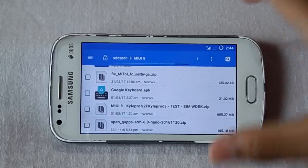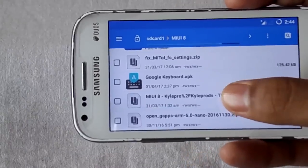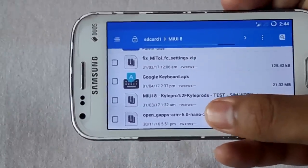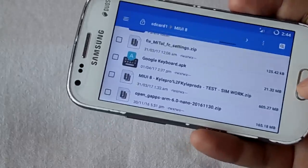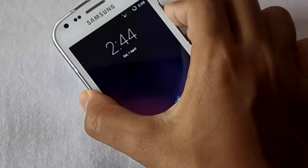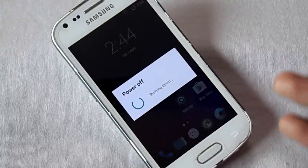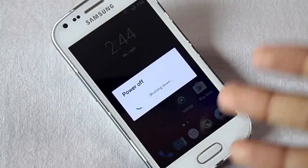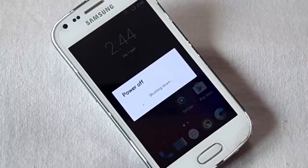To install this ROM, you first have to download these 4 files. First is the MIUI 8, the main ROM file, then the Fix Me tool, then Open GApps, then the Google keyboard. And you have to place them in your external SD card. And now turn off your device. All the download links are given in the description. You can download these files from the description, or you can download the Google keyboard APK file from the Play Store